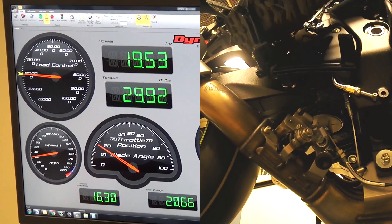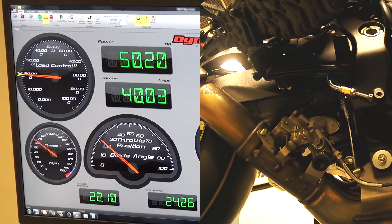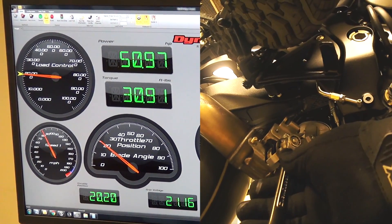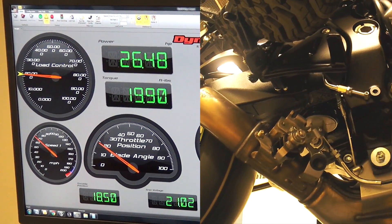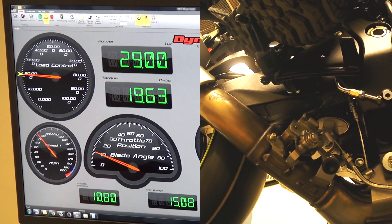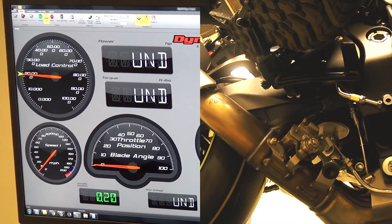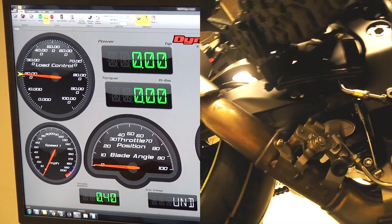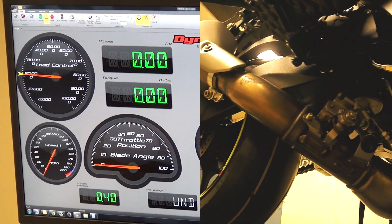We're going to make some noise. We're about 50 horsepower at 7,000 RPM. Let's put that valve on. I can feel the back of the bike move. Open it back up. Granted, these aren't the most sophisticated tests, but at those different loads and different RPMs, when we closed off that valve, we noticed a significant reduction in power as well as a reduction in noise.